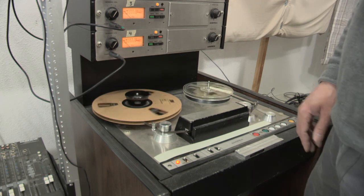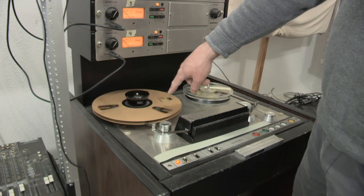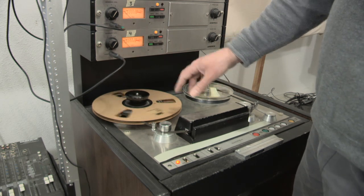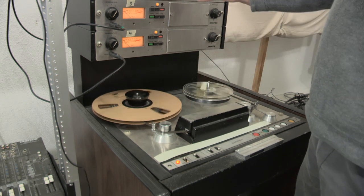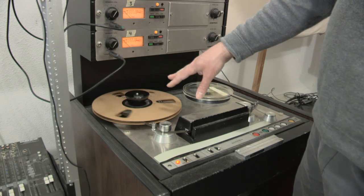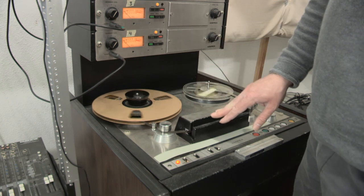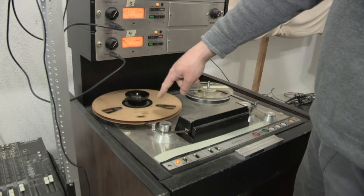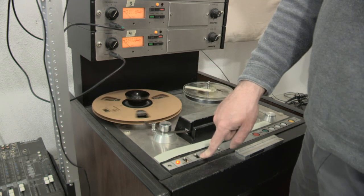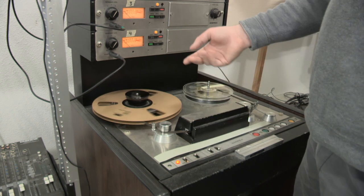Since I'm not fast-forwarding to where the first song is, it packs more evenly if you just let it play. I've preemptively set up my deck for both 15 and 7.5 inches per second since both speeds are used on this tape. When I reach the leader in between songs, I'm just going to flip the speed down to 7.5 ips, so there's less stress on the tape than stopping and restarting it.